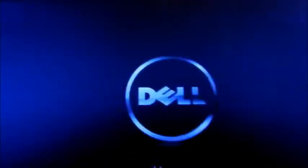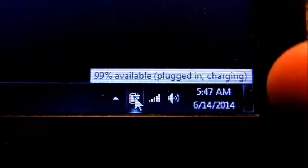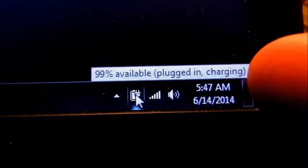The first thing you can notice is the third light — which is the battery light — is on. That might be all you need: plug in your power supply until you see the battery light is on. We don't get a message saying anything about the battery not being compatible. Windows 7 is booting up. We come down here and we see right away this little battery icon going down low and then back up — that's the charging indicator. It says it is charging. It's like your cell phone; smartphones do the same thing. So it's very important that you obtain the correct power supply if you have multiple power supplies in your house.